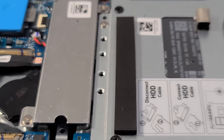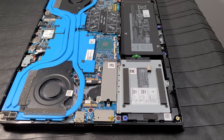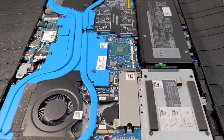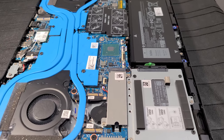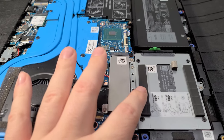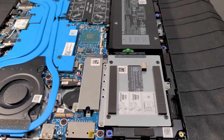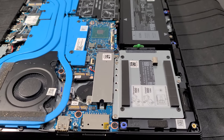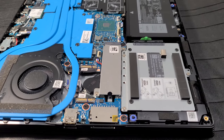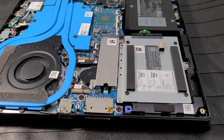I'm not going to fully reinstall it, but I'm going to put the bottom plate back on the laptop and turn it back over so the components aren't grinding against the rubber mat. Then I'll turn it over and boot it up, download the Samsung Magician - actually it's called Samsung Data Migration - software, which is just a disk cloning application, and use that to copy the files. I'll make this the master boot drive in the BIOS, boot from it, then remove the old drive and replace it with our Kingston HyperX Predator.